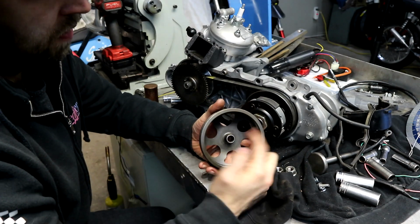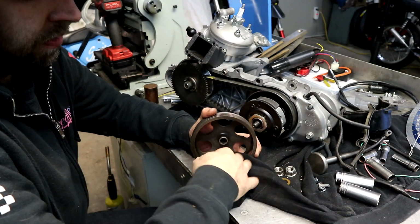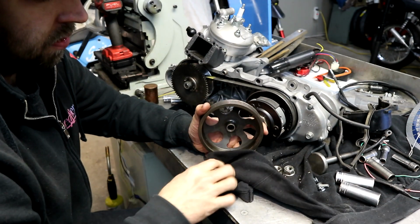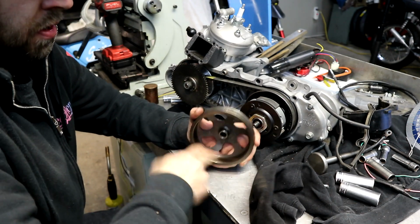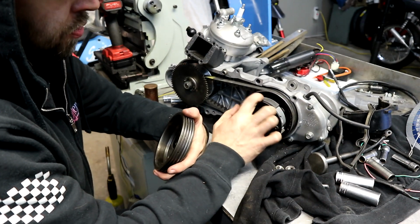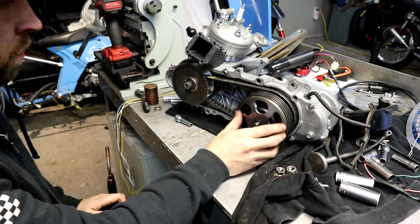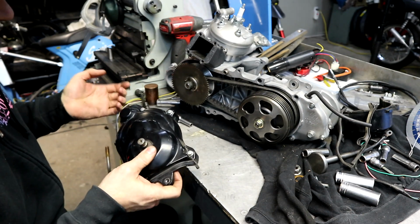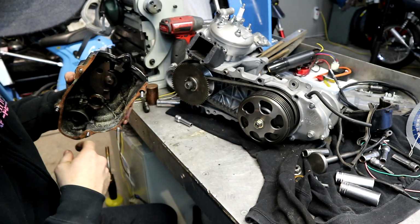But a lot of that grease, if it does fling out, will get flung up inside the bell here. So if you have some brake clean, you can brake clean the inside out. If it's all gouged, maybe a light Scotch-Brite or sandpapering, just directionally, just to clear off the glazing. You can very lightly sand the pads too, just to break the glaze so it beds in fresh again. And then once you've got all that done, you can install the cases.